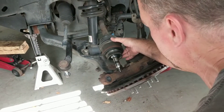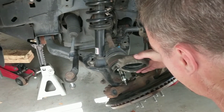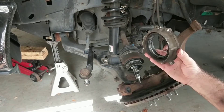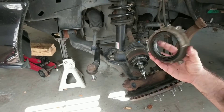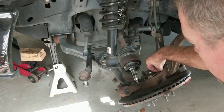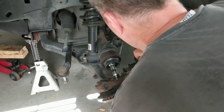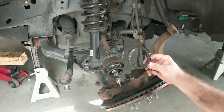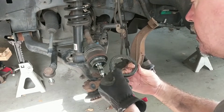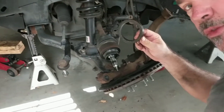After moving things out of the way, I was able to slide the old actuator up and remove it — slide the axle over and sort of wrestle it out. This is the old one that came out. It doesn't even have all the parts in it: the gear is missing and the outer plastic plunger ring is gone — it's broken off and sitting inside the wheel. Inside I can see the actual actuator ring, and while it looks like the teeth may be worn down a little, I'm just going to replace the whole thing.